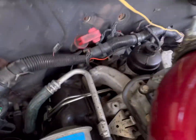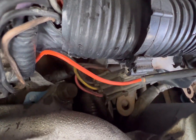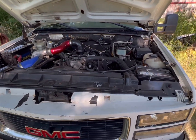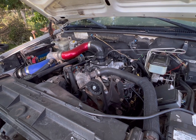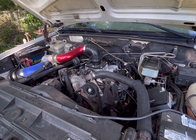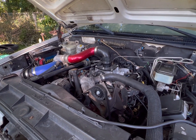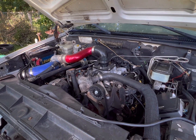The next thing after the glow plug relay is the master ground for the main trunk harness. It's down there on the back of intake runner number 7. If that ground is bad, your dash lights will do all kinds of funny things and you will have interesting problems with the truck you never thought you could have. It can actually cause issues with starting, problems with your gauges reading, and glow plugs triggering. Be sure to check that as well. If your gauges are flickering, your wait-to-start light doesn't come on, or you have an intermittent problem, that is another ground to check.